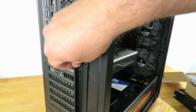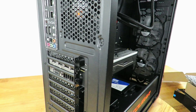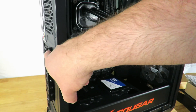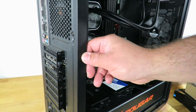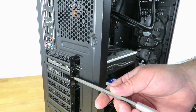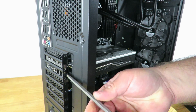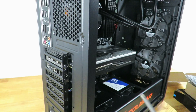That's okay — it's going to be the same process. Now that we have that panel removed, we also have to remove the bracket screws. These are normally the ones I mentioned that would be inside, but on this case they're on the outside. We unscrew this one — again, I lost the one right above. A magnetized screwdriver is always great to have.